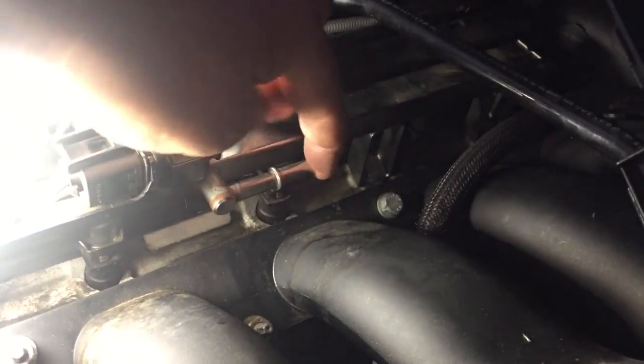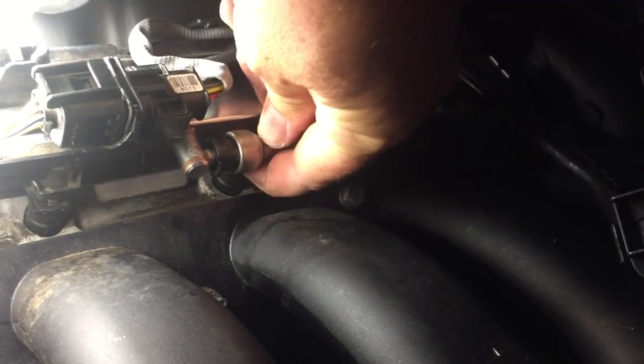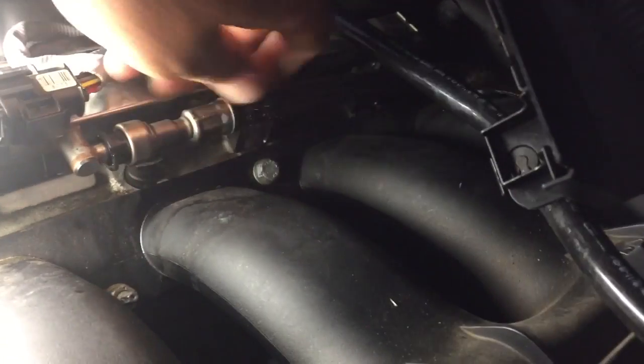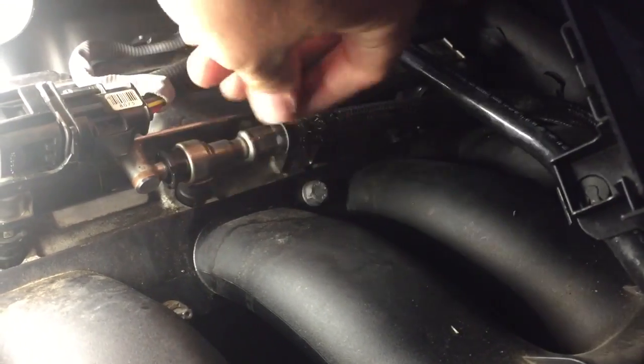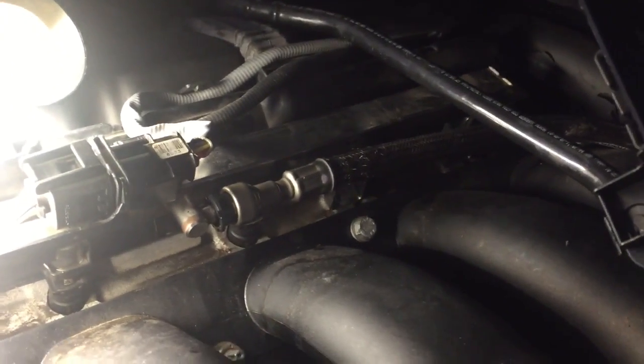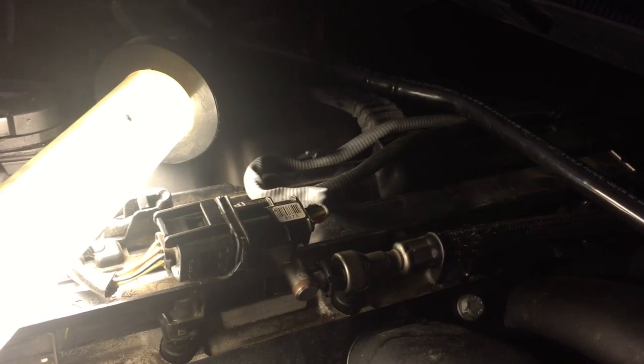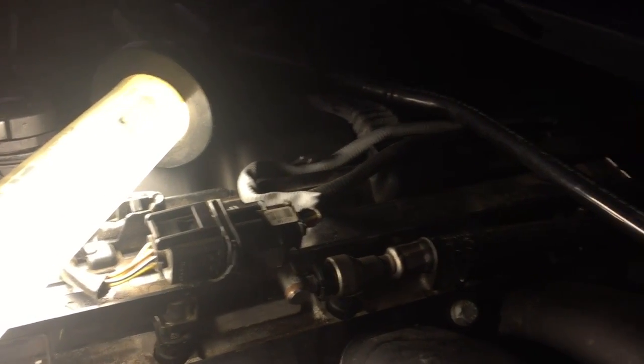And now the fuel hose needs to be reconnected, and that's your fuel hose right here. So pull that up and clip that on. Bang, clip, clip. You hear that? And then pulling it, it's nice and tight. That is nicely in place. That's good. The clicking is what we wanted to hear as it went back on, and seeing now that it won't come back off. So there we go. Now, when you first start this up, it's not going to instantly fire because there's now no pressure in the fuel rail, but it won't take long to pressurize up, and we'll get to put this back together.